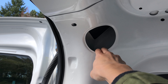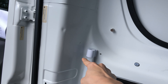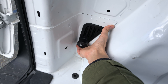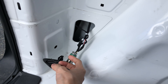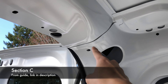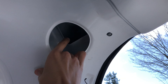The wire comes out of this hole here, and that's where they split. The power wire — the 12-volt line — goes all the way down here and comes out of this hole, which you can access by lifting. Just lift up and it comes right out. You can see I've tapped the line over there from the cigarette lighter. Meanwhile, the other wire goes from up here, goes all the way across just inside the top piece here, and comes out of this hole.